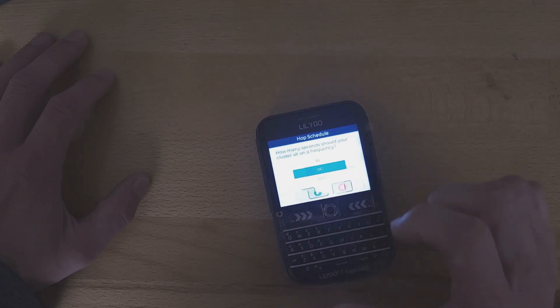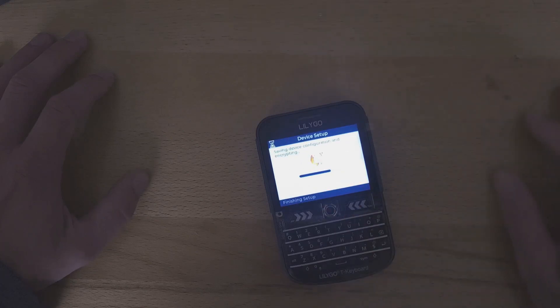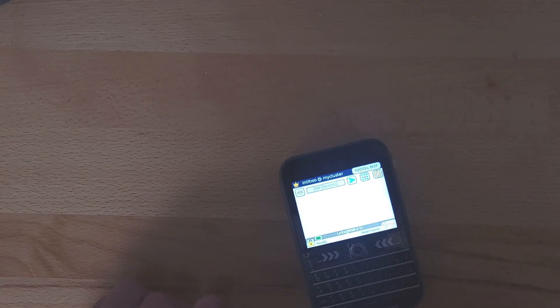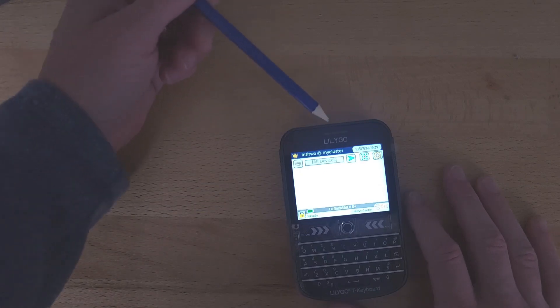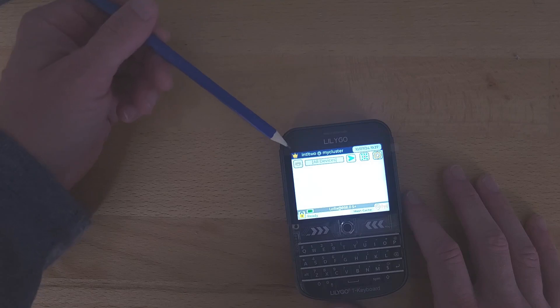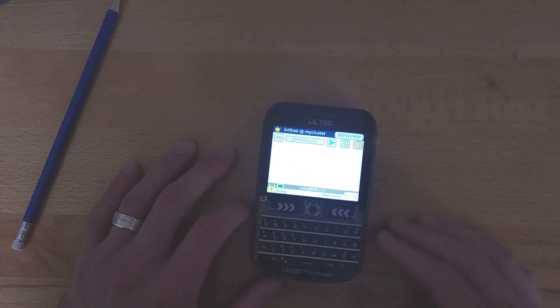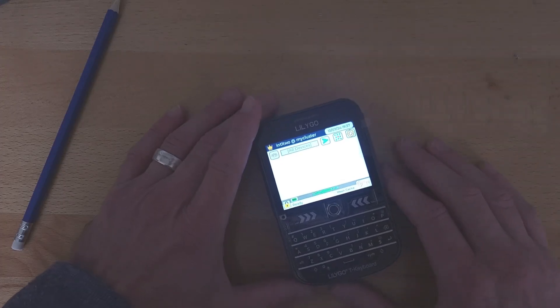I'm going to choose 64 channels, rotate every 100 seconds. It should restart here and I should see it on my new cluster. That worked — now I can see I've got this new device INTL2 sitting alone in its new cluster called 'my cluster', and it's the root device. From here I could either add other devices to this thing's cluster, or I could add this thing to another cluster, or both.